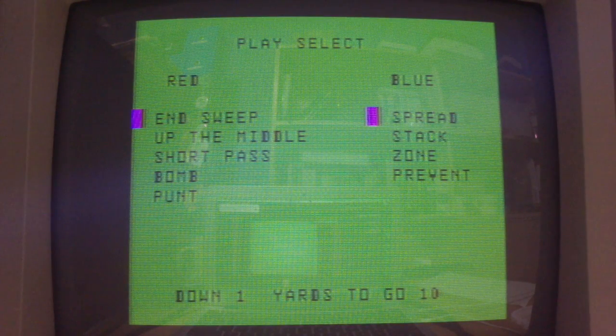I already have loaded two different things in Bank 2 and Bank 3. I'll just show you. So I'll hit reset here. I want to see what's in Bank 2. I've got video text in Bank 2. So we'll poke FF59. I will say Bank 2. We will execute the cartridge start. And there we are.